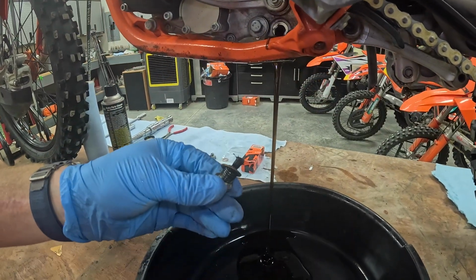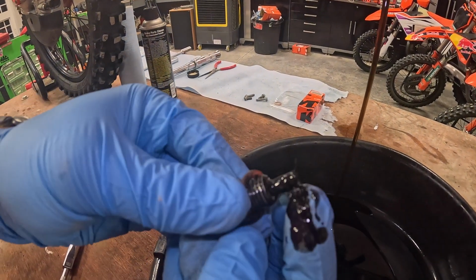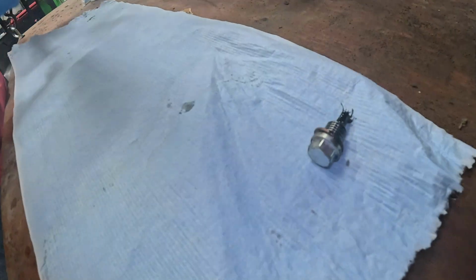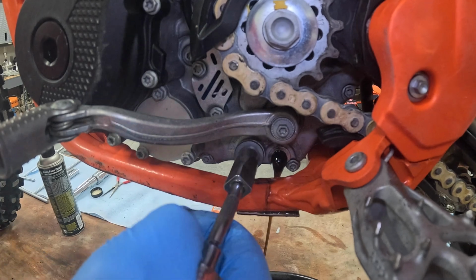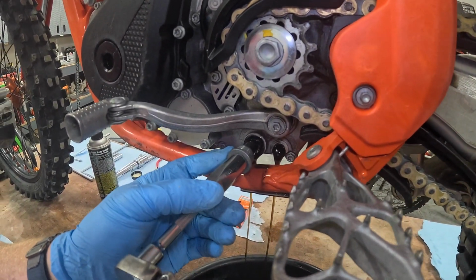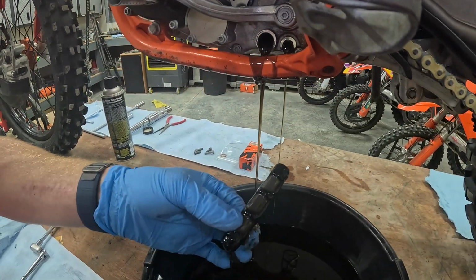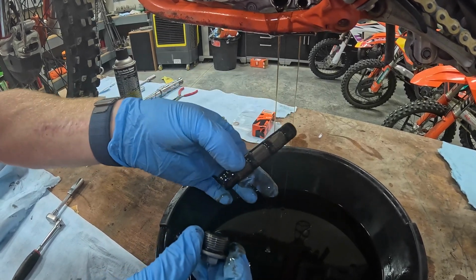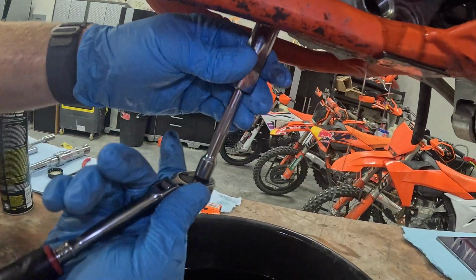So when you have a brand new engine, you're going to have a little bit of like clutch fibers, and then also just from the wearing on this magnet right here. That'll be the dirty side. Next, we're going to go ahead and pull out this second screen, also a 13mm. And so actually it ended up coming out, but sometimes this screen comes apart from here and you'll want those needle nose pliers to go ahead and pull that out of the engine. On this one, it was all good. Lastly, we're going to go ahead and pull this plug out from the bottom.